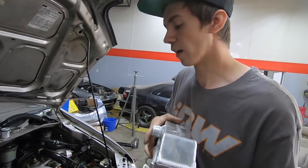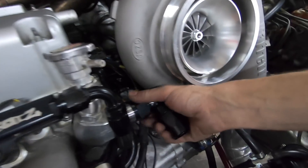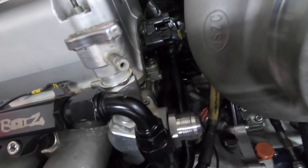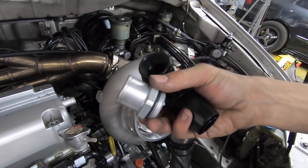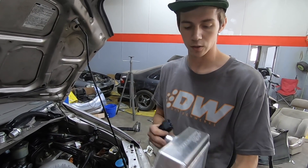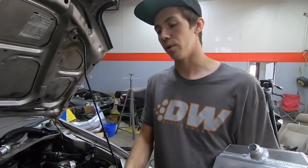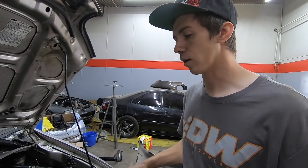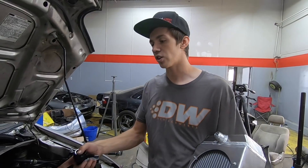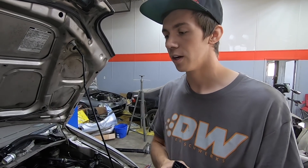We're also getting the AN lines made right now. We had to order all dash-16 AN lines — got this 90-degree fitting here, it's going to clean everything up nicely. K-Tune sent us these little pieces to adapt to dash-16 instead of the barbed fittings that were on there for a regular radiator line. We'll run all dash-16 lines to our new Speed Factory radiator. We also need to get the downpipe on, got a brand new battery to put in, then start going through it, fire it up, get all the fluids in. We also checked the valve lash while we had the valve cover off and everything is looking good — just trying to get this ready for the beginning of next week.